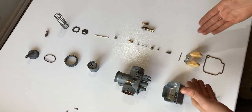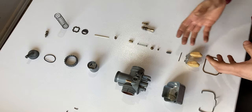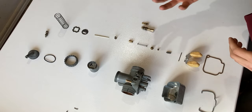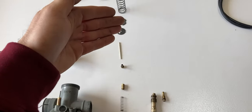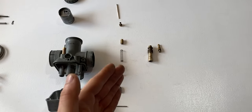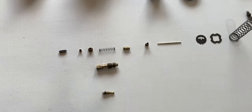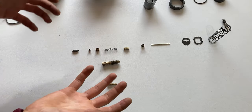We also have our fuel tickler — this is mounted externally and allows you to add a little more fuel into the bowl of the carburetor. It touches the float bowl and allows a little more fuel to come in, which might give you an easier cold start. This one may have to be replaced as the rubber is not in great condition, but I'll see if I can find it online. All the small internal parts are made of brass and machined to perfection to ensure the proper fuel-to-air mixture leading into the combustion chamber.